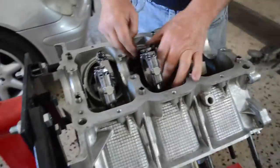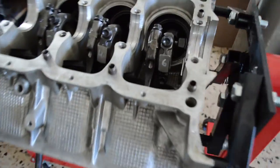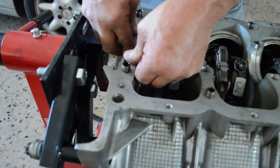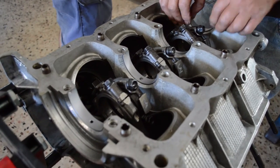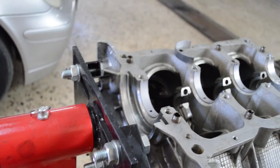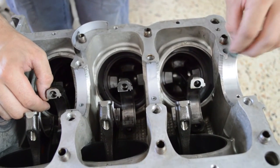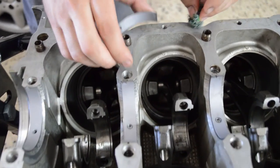When all pistons are in place, the sleeves are locked with a special tool so as not to fall over when the engine is rotated upside down. When the engine is upside down, the connecting rods are inspected and properly placed next to one another, so that the bottom cap of the connecting rod is marked and taken out to prepare for placing the crankshaft. Since this engine splits in half, the next thing to do is to prepare the facing of the block in order to mate it to the other end. Everything must be properly cleaned, and when prepared the engine is sealed and bolted back together. That will be continued in the next video, so stay tuned and thanks for watching.